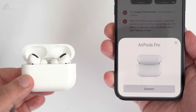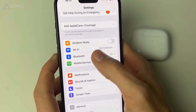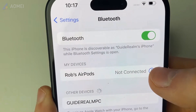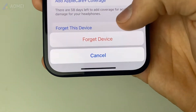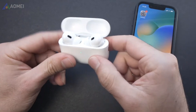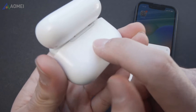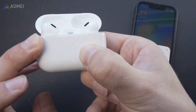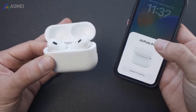Next tip: reset AirPods. Go to your iPhone settings, scroll down and tap on Bluetooth. Under the My Devices section, you should see your AirPods listed. On the AirPods settings page, tap on Forget This Device. Locate the small setup button on the back of the case. Press and hold the setup button until the status light starts flashing orange. Open the lid and follow the on-screen instructions to pair your AirPods.